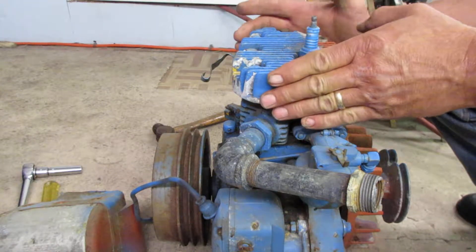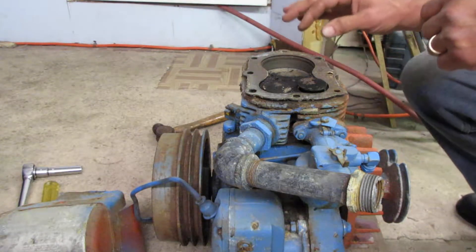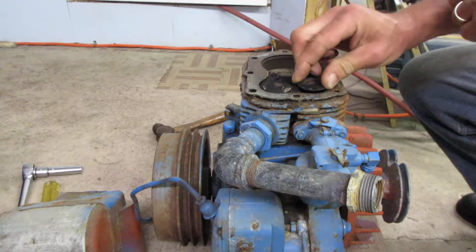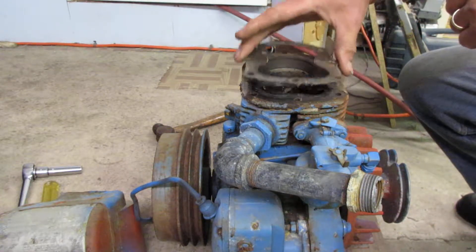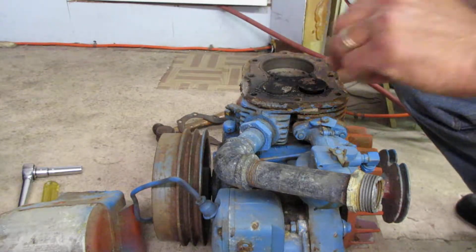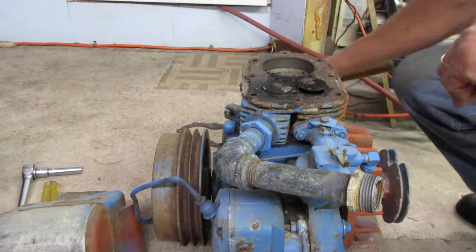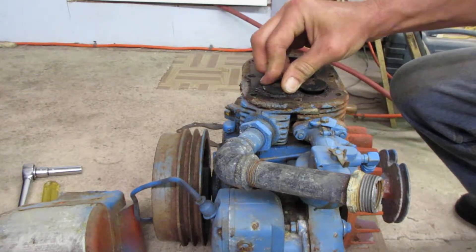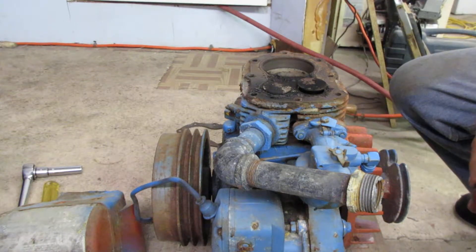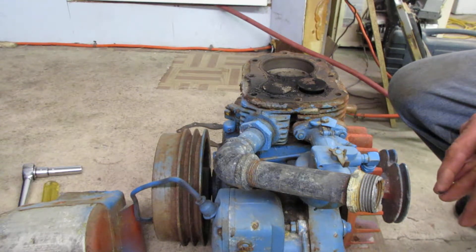Okay, so let's just pull it off. It doesn't look very bad in there. That valve is free. Maybe that's why it's stuck — maybe that valve is seized. Either that, or possibly we have a blown rod or a bad crank.